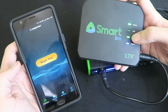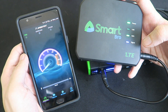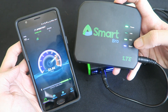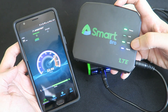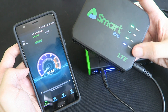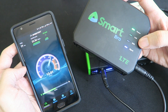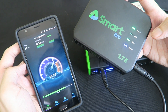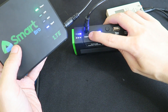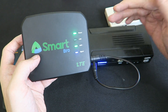So I'm connected to the home Wi-Fi again. Let's do a speed test — we're not actually interested in the speed. The reason we're doing speed tests is it puts a lot of traffic through the home Wi-Fi very quickly, putting it under a heavy load which means it draws a lot of power. We're doing this to see if the router reboots itself or loses its connection, because that's what would happen if it had power issues. But as you can see it's completely stable, which is expected because this power bank can output around 60 watts on this port.